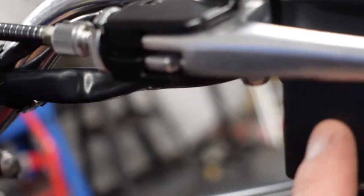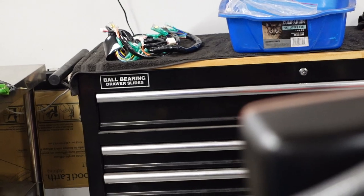And so, depending upon your speed, that basically counts how far you've traveled. So you put your turn signal on, and that counts how far you've traveled, and this little module will send the signal to shut off the turn signal. How does it shut off the turn signal? It does it with this little motor. There's a little motor in here, and with it in right-hand turn mode, that will physically turn it off.